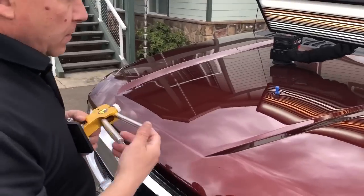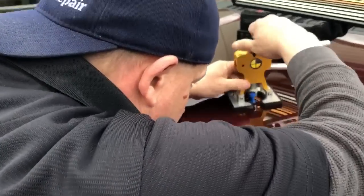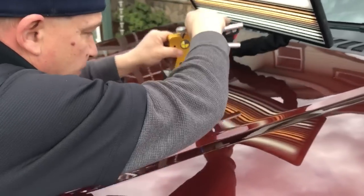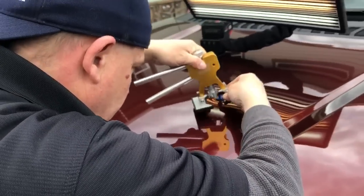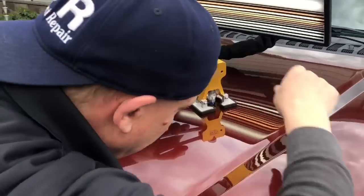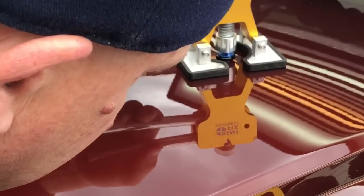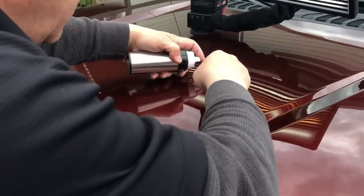We've made a pull or two. Coming in with a smaller tab now. I don't want to pull it from that direction — wherever the feet have the solid side, it's gonna pull the most. I've pulled almost all my pulls from the top side, so I want to pull this one from the bottom side. It's gonna pull more from the bottom foot. Let's just pull it up nice and slow and let it find its release point.